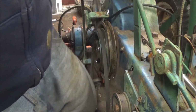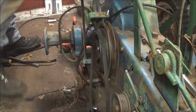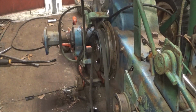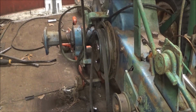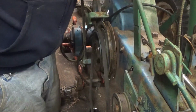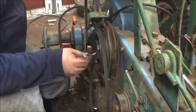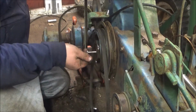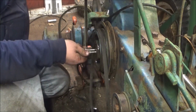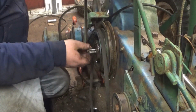I'm looking to see if I have something stronger other than grade 2, and that's why those bent. Grade 2 is basically like a shear bolt or a shear pin. It's very close to the shearing strength. You have to also work on that. These are also grade 2. I don't think I have any better grades right now.